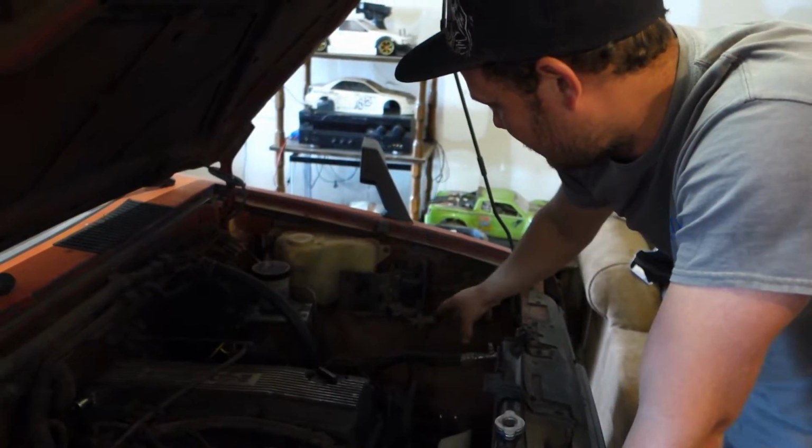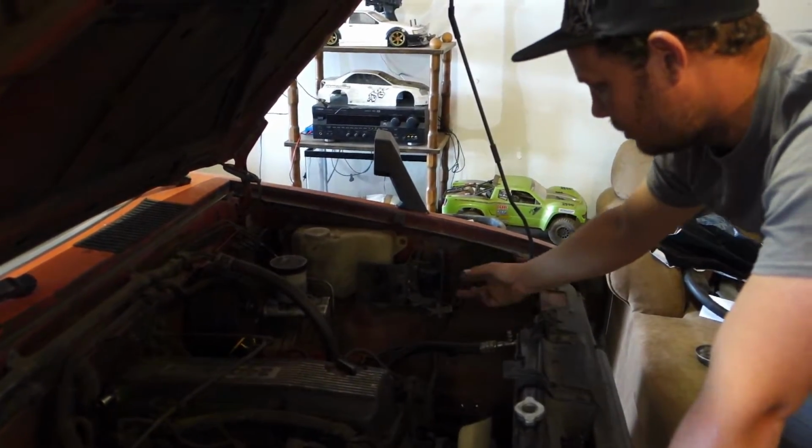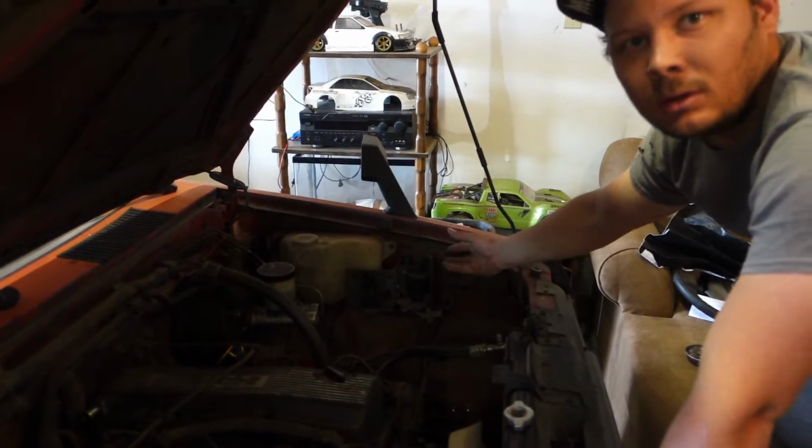Whatever. But what you can do is, as you run this over here to your turbo, you can take your wires and extend them across, and you can use a 240 housing and make that up to your intake on your engine. Or if you're doing a cold air intake, same. Or you can always buy one of those intake air temperature sensor bungs and get an air intake temperature sensor off the internet or something.